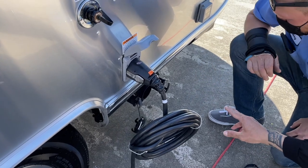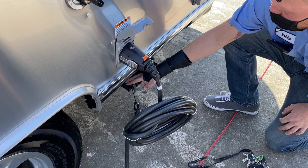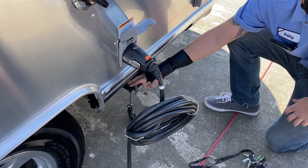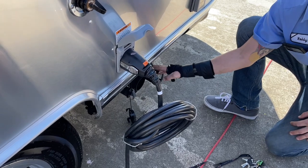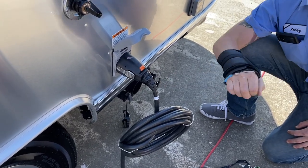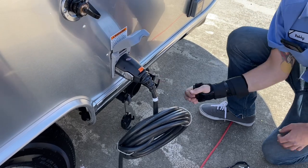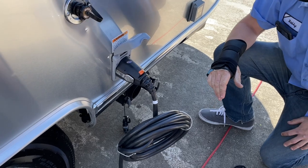What's the purpose of pulling two different ones? This is your kitchen water — your shower water, anything that's not the toilet. The black is just the toilet. You want to pull the black first, and then pull the gray after, because the gray is going to come through and also assist in cleaning out the black.